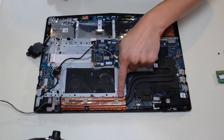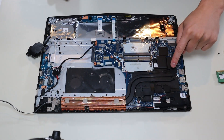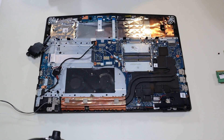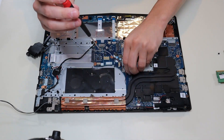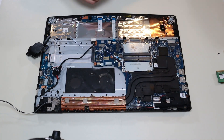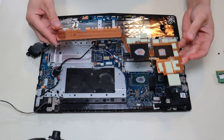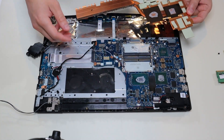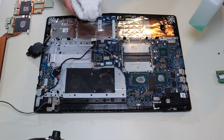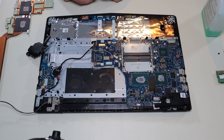For the rest of the heat sink assembly, it comes down from the vent. It looks like a screw here and here, one there, one there, and one there — that looks like that's all there is. Let me go ahead and take those screws out. That picks up the whole heat sink. So that's what you're looking at underneath your heat sink — and those are your chips right there. I went ahead and took a lot of the large junk off there as much as I could.